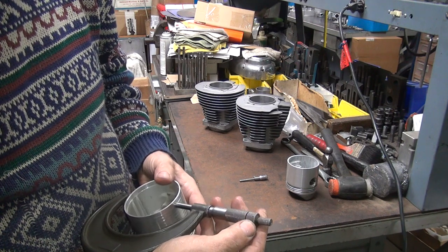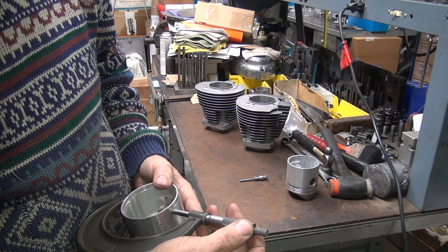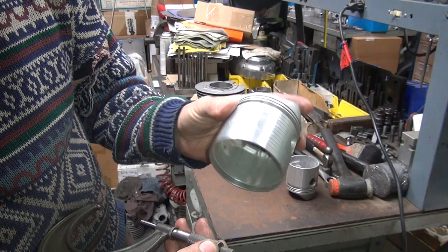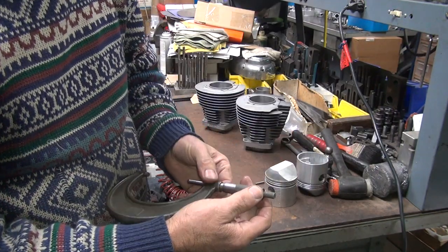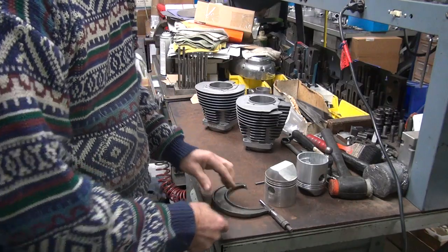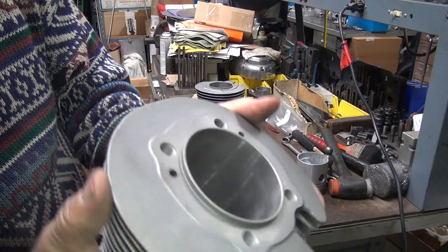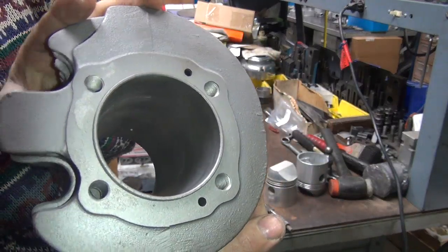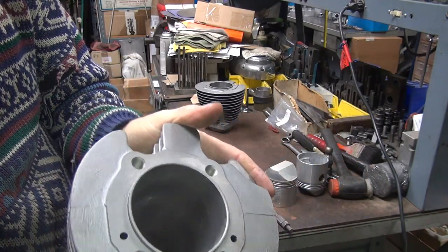That's got a lot of taper right at the very tip. Jeez. And you still got to put clearance in there. So we have a good 8 thou we're going to clean out. Which is all on the good side. But same deal. I don't think this thing is going to clean these big gouges in there with only basically a 10 thou bigger bore. We're only going to be cutting about 8 to 9 though.